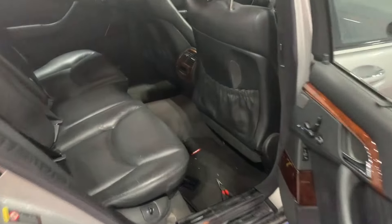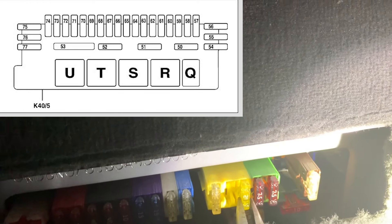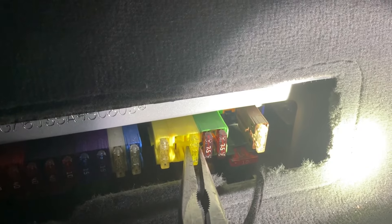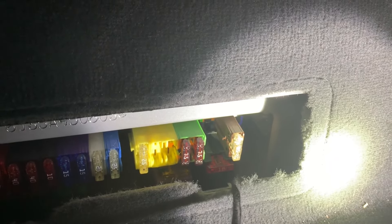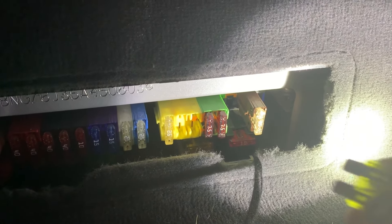There's a fuse block almost nobody knows about — it's hiding down here on the floor behind the light. With the panel off, you want to pull fuse 62. It's the first yellow one, in the first yellow block, first position. Pull the fuse. Whether it's blown or not — if it's blown, replace the fuse. If it's not blown, you can put it back in and see if the system functions. However, there's still going to be a failure — let me show you why.